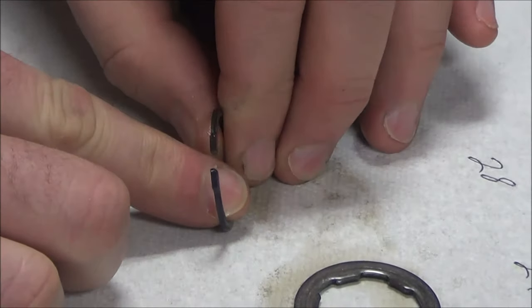Check this out — look at how deep the grooves are where they're rolled off. This is just like Brian's here, and you can really see where it had the wear. That's going to be nothing but noise and problems. When you have that soft edge under heavy load, you're going down the road, you give it gas and lock these gears — the friction of the tire on the ground and these warped gears will cause this to slip and then slam into the next set of holes. The shift fork is saying you need to stay there. But when that groove gets bad enough, your customer will say, 'I get a bad clunking when I accelerate my bike.' It's rolling out of there because it can't retain itself — this doesn't have a good surface or isn't deep enough to hold it in place anymore.